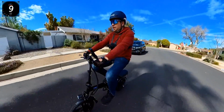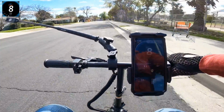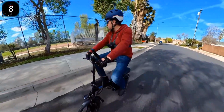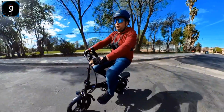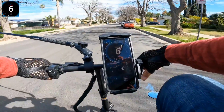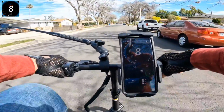The air pressure in the tires can be between 35 to 45, and I believe I put like 40 psi. The brakes are mechanical, 160 millimeters, which can easily be adjusted. And if you don't know how to adjust them, you might check the link in the description or take it to the bike shop. So I'm gonna test it out now, pedal assist level 1, to see how fast I can get on pedal assist level 1 with pedaling.